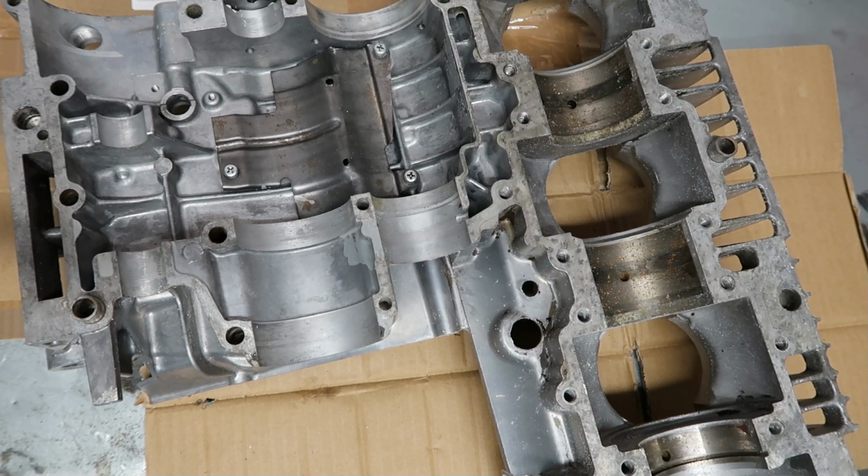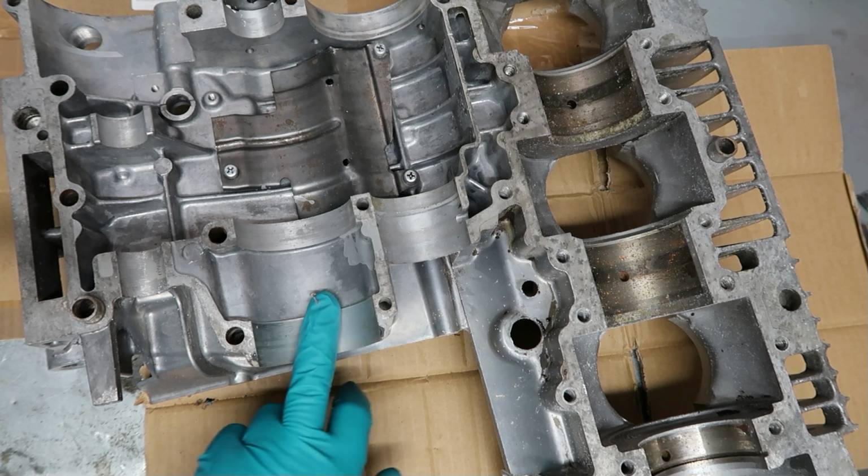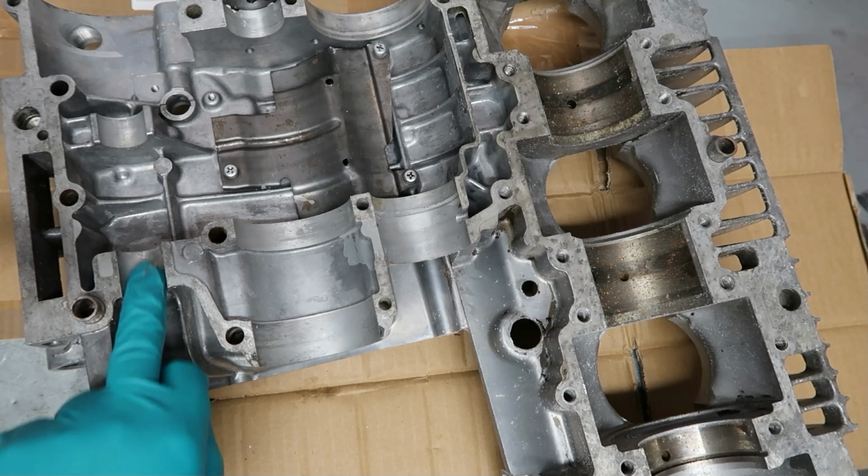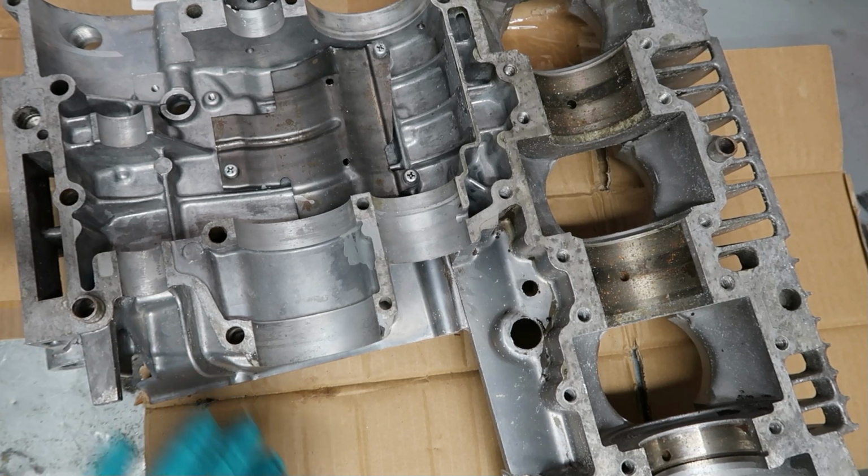You need to have that compression. That's why, when you see people say, oh, it's a worn housing, I'll just use bearing fit, absolutely, you use that if you've got to. I've done it, not on an engine, but when I used to be at sea in the middle of nowhere, you've got to do something. But you just have to be mindful that it's not going to last like it's supposed to last. So yeah, we'll crack on.